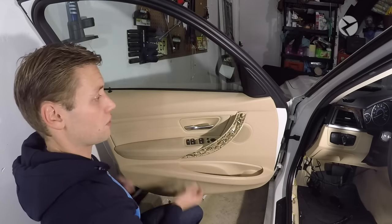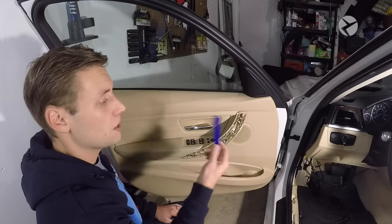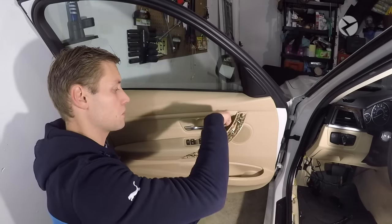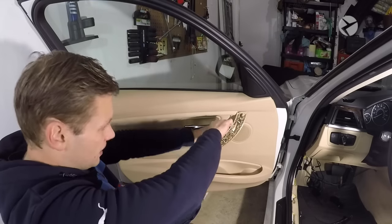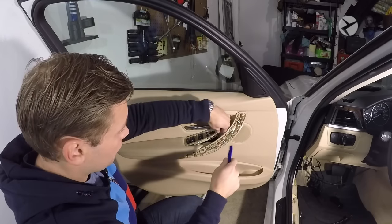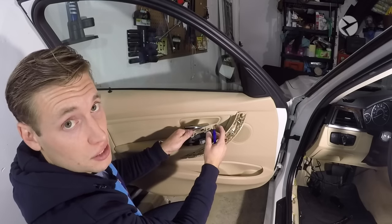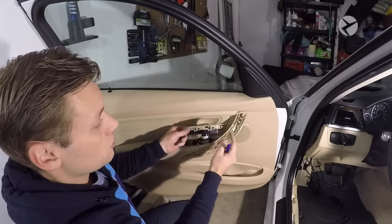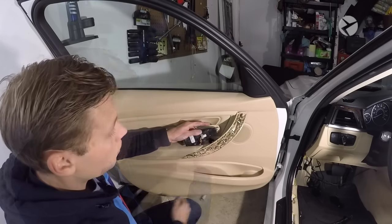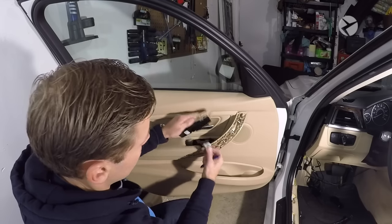Once you've released all of the fasteners on the side and it's just hanging on by the top, remove this control panel. Find the thinnest trim tool you can — the Beamertek one with the flat edge works best. Slide it in and gently pry up the front and then slide out the back. There's a tab in the front that secures it in place and the rear just has pins. Once you're here, press in this little button and slide the lever down — this will come completely off.